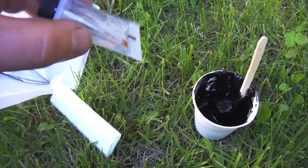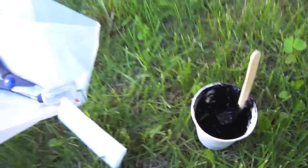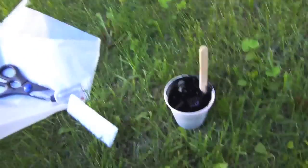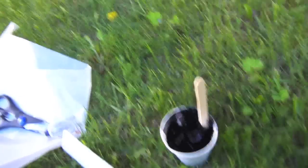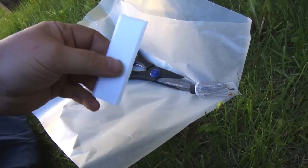Now we're ready to add the hardener. You mix the hardener according to what it says in your instruction manual — it may be different from mine — but after it's mixed it says you have 15 minutes of working time. Then you use your stir stick to put the gel coat repair into all your cracks. After you're done, use your wax paper, put it over top of it, and use the putty knife to seal it.